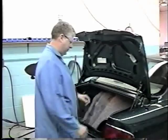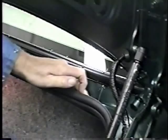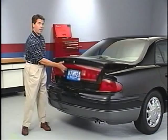First leak that we got is right here. It's called the parcel shelf. On the parcel shelf, usually there's a seam that's been skimped. The metal's good, but it's just been an operator insulation area and it's just been skimped. One possible source for a water leak in early and sometimes current production cars is the seam on the parcel shelf gutter below the rear window.